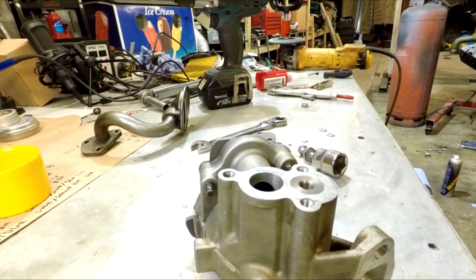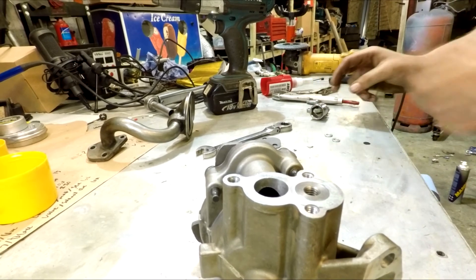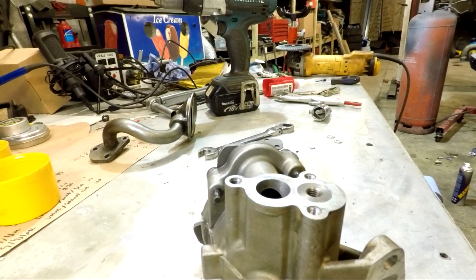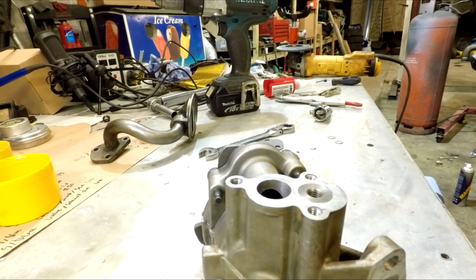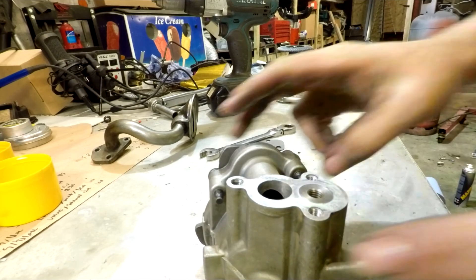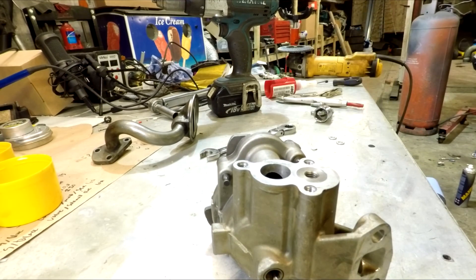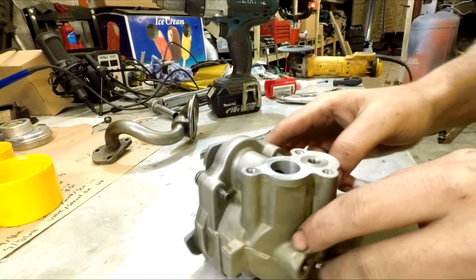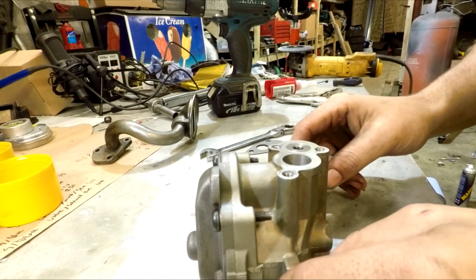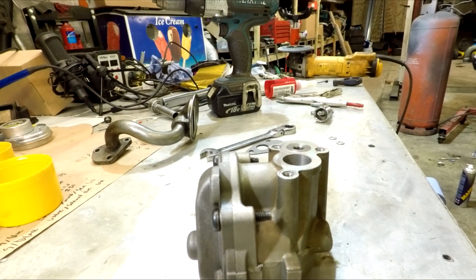With that done, the spring is spaced out about another three millimetres or so, and that should increase the pressure. I'll put in the description what the final pressure is once I know — but until the engine's back in I won't find that out. But yeah, as simple as that — that is a basic guide on how to increase the pressure on a 2.9 oil pump. Probably the same with the 2.8 and all the Pintos and probably even the crossflow. Very similar old Ford stuff. If you enjoyed the video, give it a like, comment, or tell me what I've done wrong, and drop me a subscribe. Cheers.